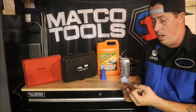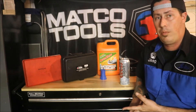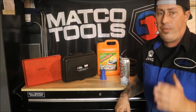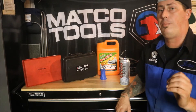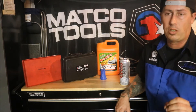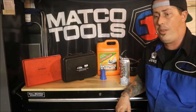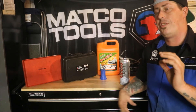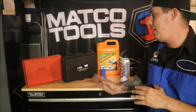You just got a chance to see how the coolant pressure tester works, how the Venturi bleeder works, what comes inside both kits, the various types of adapters, and how it all ties in together. These are very crucial tools for an automotive technician because there are times you'll run across cooling systems that never seem to want to be free of air — it gets trapped, starts to overheat, and you have to crack bleed screws, wait for air to escape, close them, and sometimes put the vehicle at a slight angle. The Chevy Venture I worked on is a prime example — we had to bleed that thing for about 4 days to get all the air out, and not even the Venturi bleeder was able to pull all the vacuum out of it.